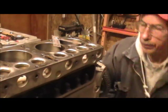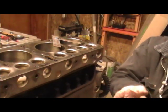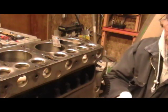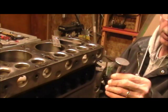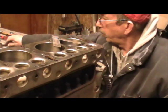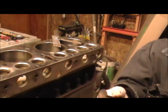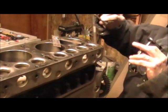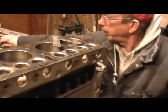I've taken the valve and ended up grinding about 15 thousandths off it, based on what I saw on the gauge and my experience. This valve, by the way, is a stainless steel valve — a modern one-piece Model T valve. What we're replacing were the original two-piece valves that are put together, and they can break apart. These were beat up really badly, especially the exhaust valves.